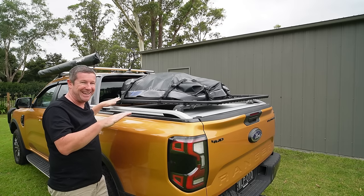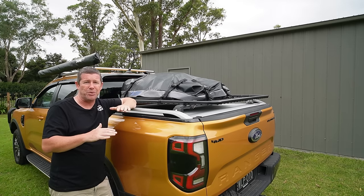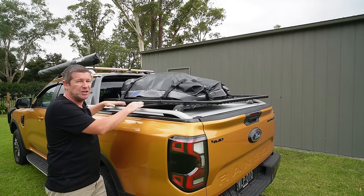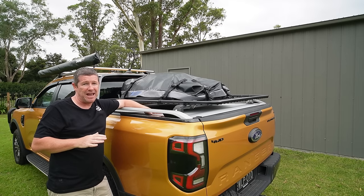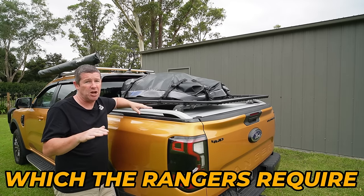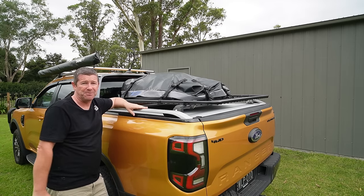I'm still 50/50 on what we do here, so I'm just trying out different things. If you're the kind of person who'll constantly use a tub rack, I'd buy a purpose-built one suited to your ute — whether a Front Runner style, a Rhino version, or an eBay generic aluminium platform with legs. Most eBay ones are made for standard steel tubs without roller shutters, so some modification is needed, similar to what we did with the King's tub rack. These roller shutter supports can bring the load rating up to around 300 kilos — ideal for a tub rack or rooftop tent.